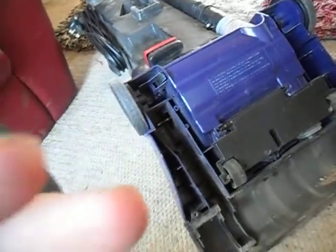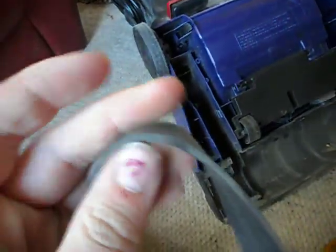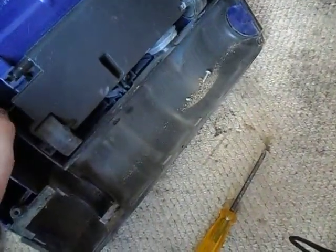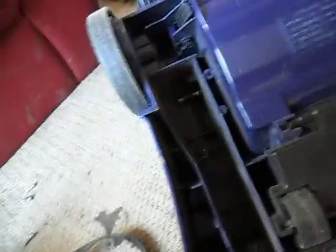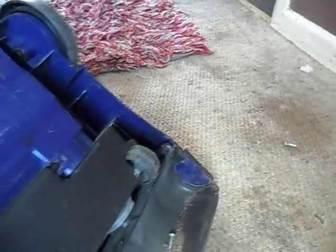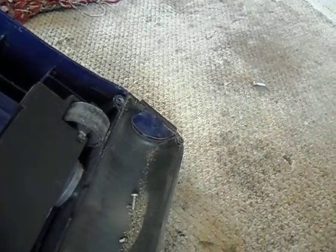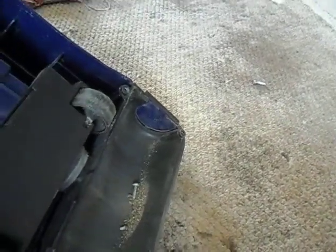I can see a break — I don't know if you can see that, but there is that mark on the belt, which basically means it was stuck. Right there, which you can't see, is basically black, and the motor smells like it's burned as well. So basically we've got an issue on the belt, haven't we. It did burn, as you can hopefully see there.